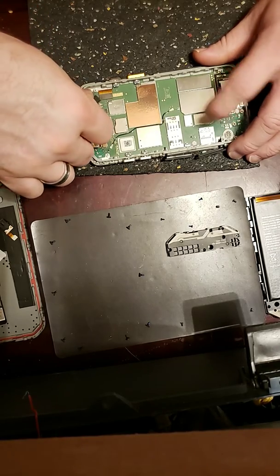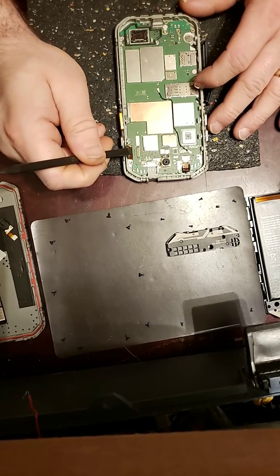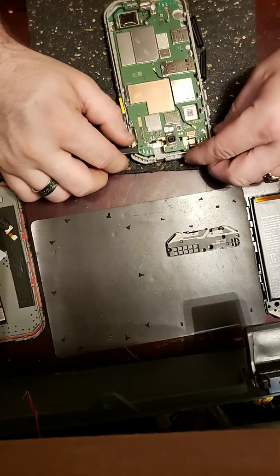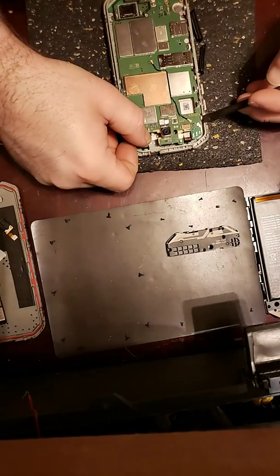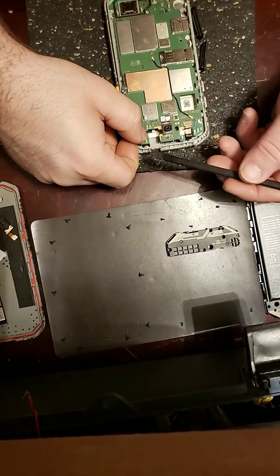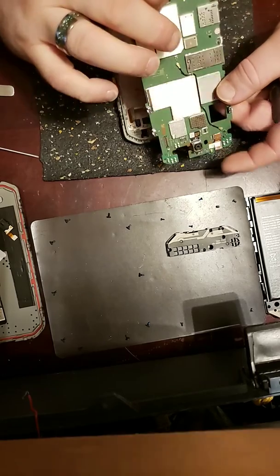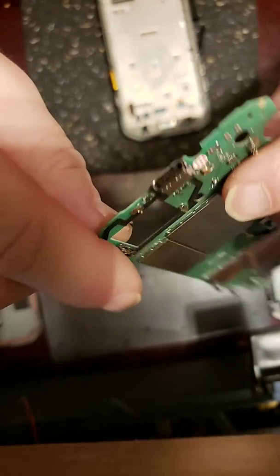Here's your connector for the screen. Once you've got your headphone jack gone and your screen connection gone, the front camera and rear camera are attached to the board, so at that point just get your board up. There's one spot on the inside — a little gray part of the frame that actually snaps over the motherboard. You need to start on this side to pry it up and pull it to pop it out of the gray side. Wiggle it back and forth while you pry it up toward the top, then pull the charge port out of its base. And there's our actual issue — you can see a little piece of the charge port sticking out. They wanted the charge port replaced.